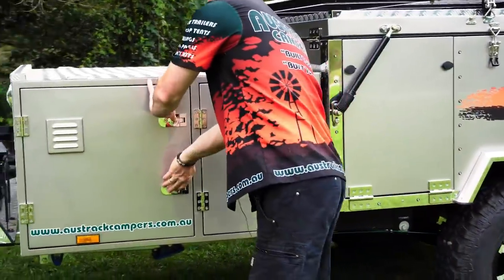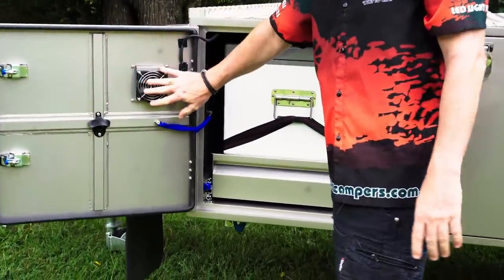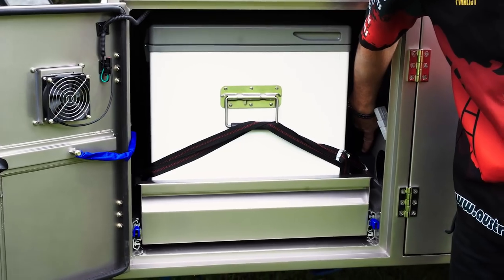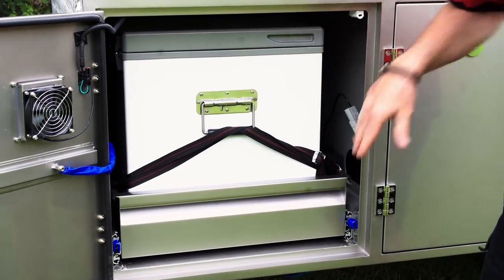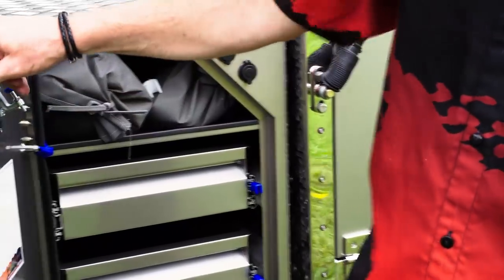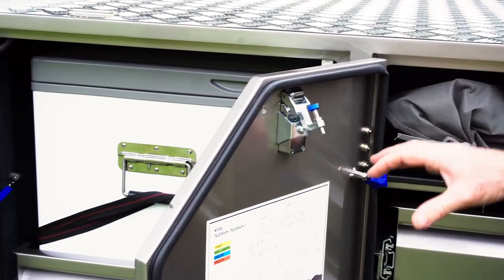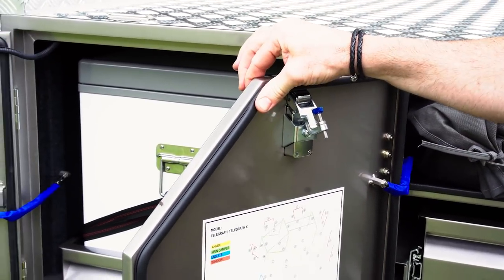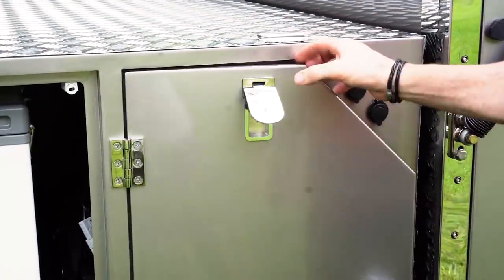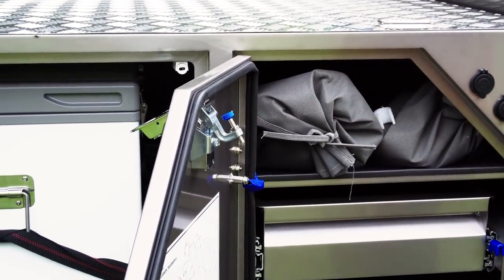Around the front in your fridge area, just hit those couple of buttons to open up all your catches. You've got a little ventilation fan here — there's a switch on the right-hand side that turns it on, and also a 12-volt accessory outlet to feed fresh air into your fridge space. All catches are adjustable on all doors and key-lockable. There's a dual pinch weld seal that can be adjusted; tighten that screw to pull it nice and tight so no water or dust gets in.